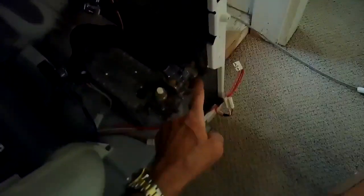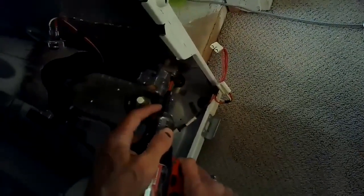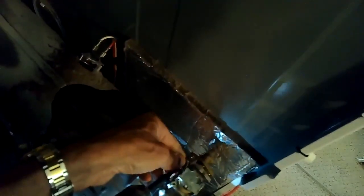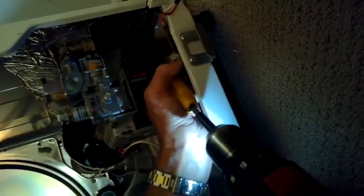We've got it unplugged and we're going to turn off the gas. We're going to remove these two Phillips head screws holding the gas pipe on — we've already turned off the gas. There's a Phillips head screw and another one. That one's off, and then there's also one underneath right here. We're just going to use a special tool to get to that upward angle, and we've got out that little screw.